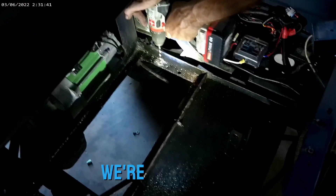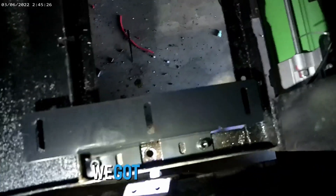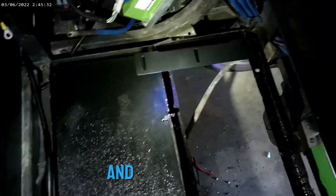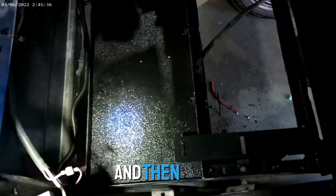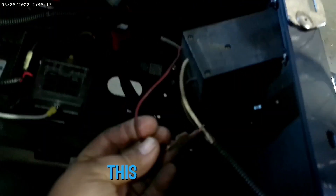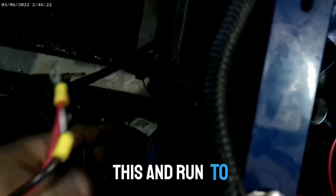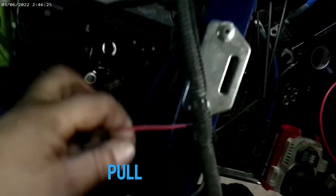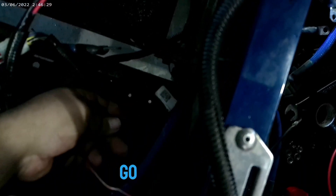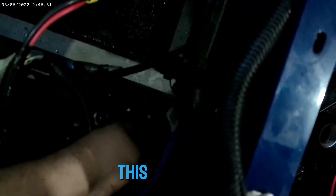So we marked our holes for our brackets and drilled them out. We got our brackets mounted in there, bolted it down. We're going to drop the battery in and get it bolted down, start wiring, and then we'll work on mounting the charger on board. So when you're doing a 36-volt TXT, this is your reed switch wire coming off the charging port. On the other side — the loom side — you need to take this and run it to your battery positive. So we're going to pull the charge port out, cut this wire, and extend it. This is going to go to battery positive. If you don't do that, this cart will not run.